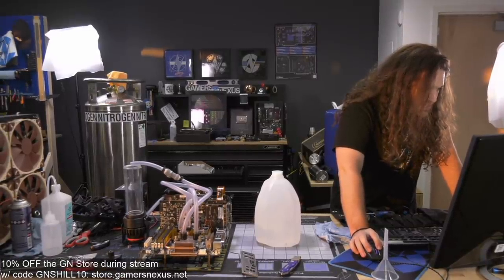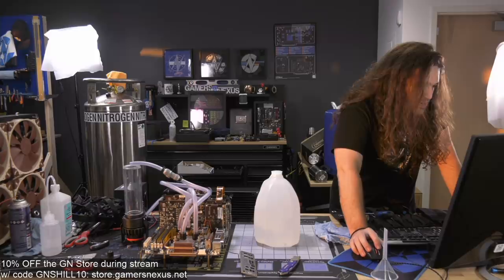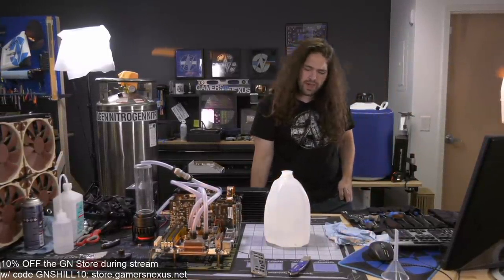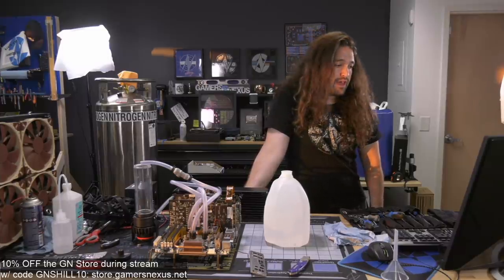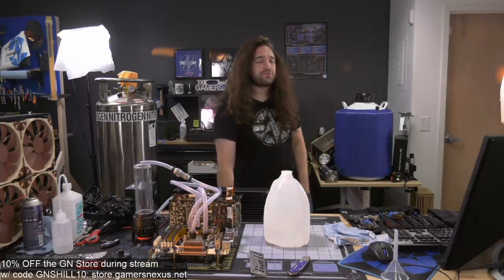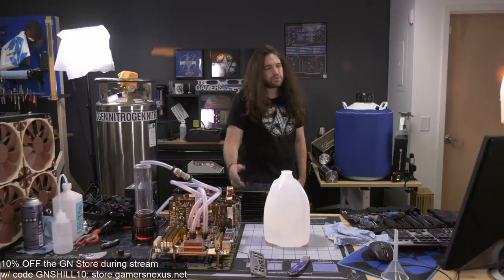Dissident Agnostic, $2, thank you. When are you going to retry a 5 gigahertz 3900 XOC? I actually have done that since. We've had it running to 5.3 now. And the trick was to bring Infinity Fabric down to 1467 and to drain the LN2 pot that one time. It got too filled with water. So we ran at 5.3.